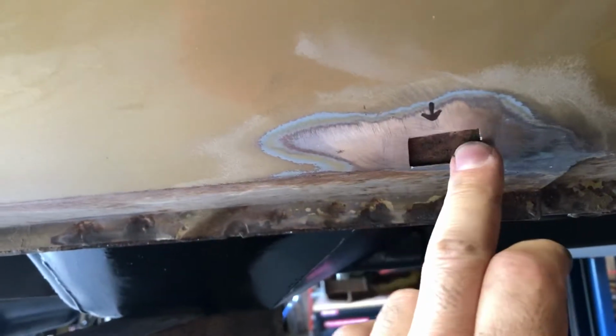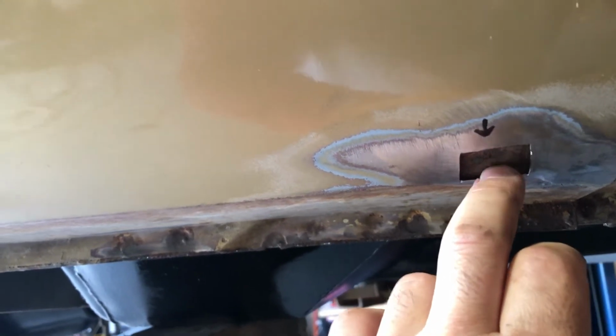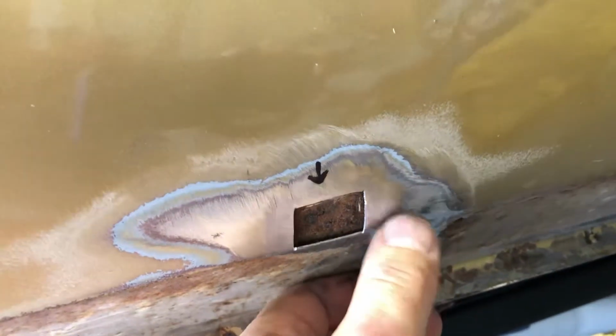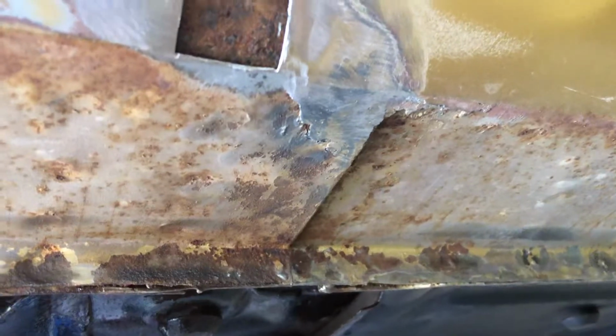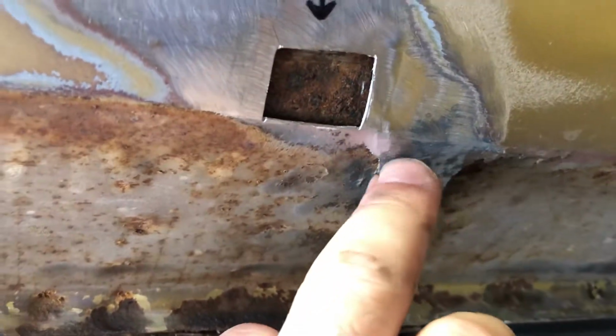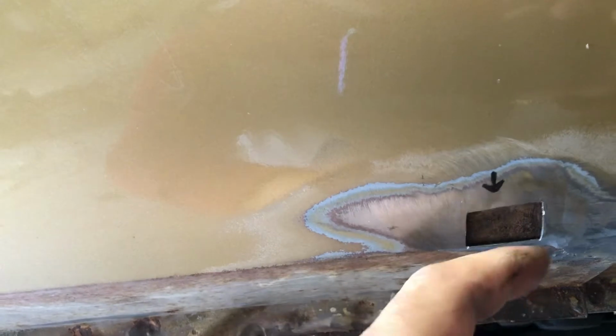Today I just got into this guy. This was a tiny little bubble, and then it ended up being a rust spot. But I actually exposed the lead of the car. See this discoloration here? That's lead filler. You can see it. That's all lead. It looked like the car had been skinned. It looked like there were two different layers, like the outside had been ground really thin and rusted through. But it was actually the lead layer over top of the rust spot.